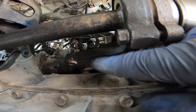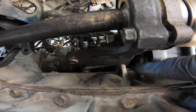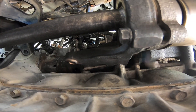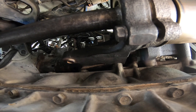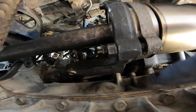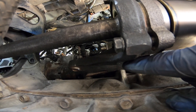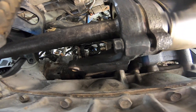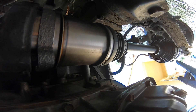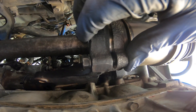On the GTIR motor there are only two bolts used. I cannot remember if there were two here before, but I have one bolt, so I put one bolt in with Loctite. This car is going to have no issues at all with one bolt, so don't freak out about it. I did have to loosen up the carrier bearing so I can line up this bracket onto the block better. I'm going to get the axle in on that side and then come back and tighten these up and see if I can close this gap all the way.